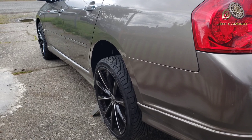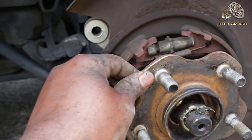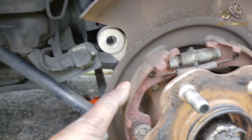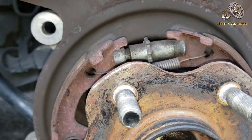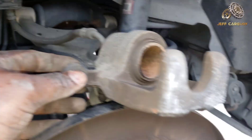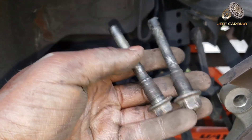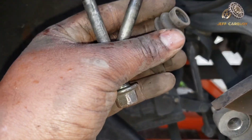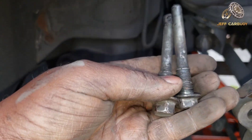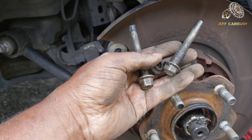That wasn't the issue either, so I went ahead and took off the wheel along with the brake rotors to get a better look at what was going on. The parking brake components looked good. But when I inspected the sliding pins, they were super dry — completely dry. That could be one reason the vehicle was dragging the brakes, because those sliding pins need to be properly greased.